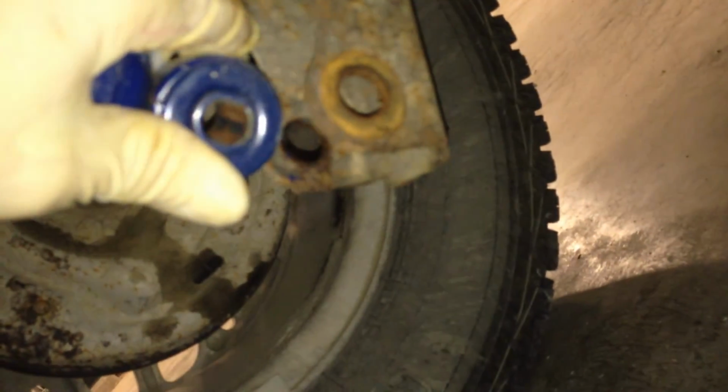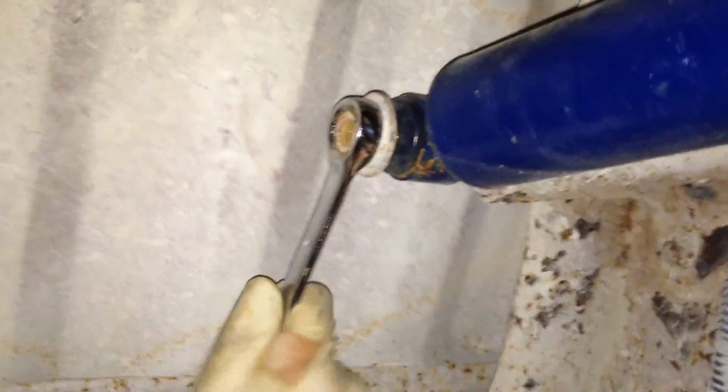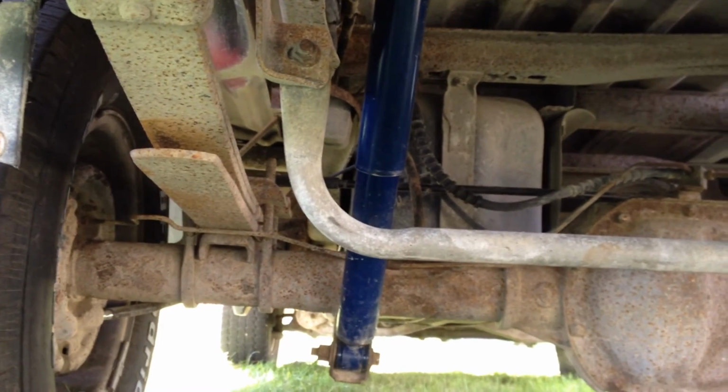And here's a shot before I go and put everything together. I just got it, like I said, this top side, the wider of the two sides, goes up first. I've got the bolt in, and over here in the bracket, I'm going to just turn this, grab my bolt, and slide it through as it starts to decompress. And there it is, loosely put in place. So I'll just go ahead, snip this wire off here, and then tighten up both the bolts. And once you've completed installing the other one, you should be done.